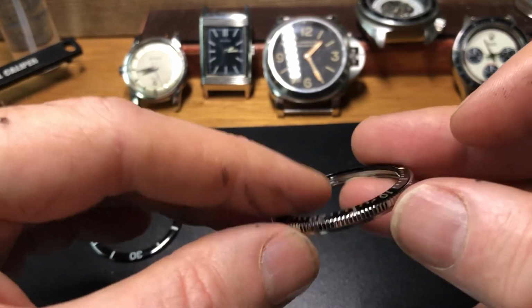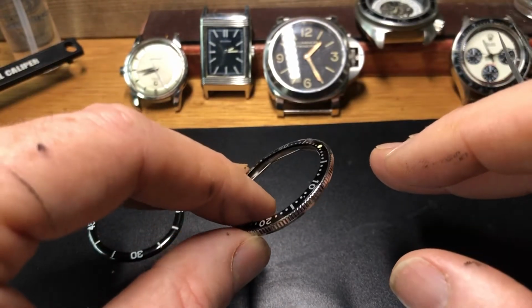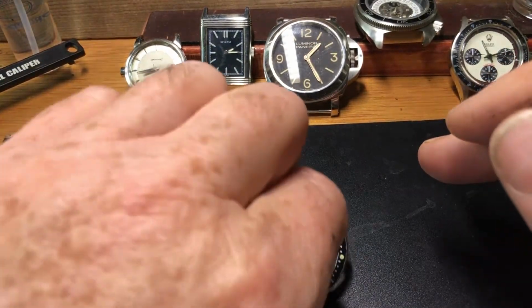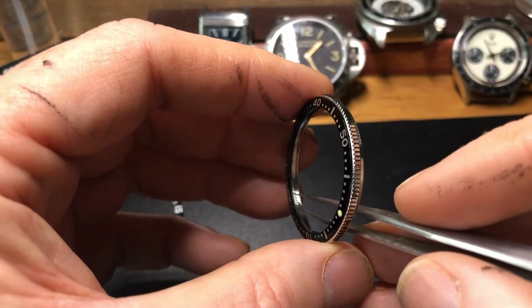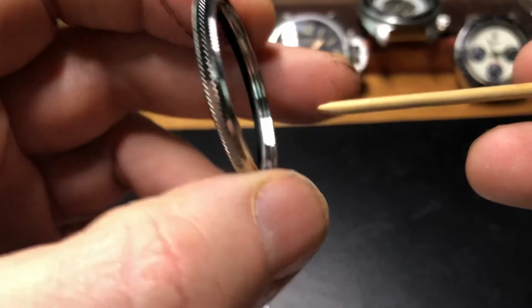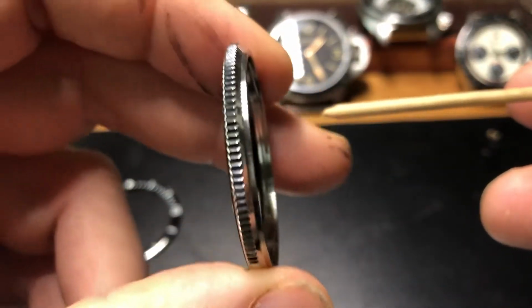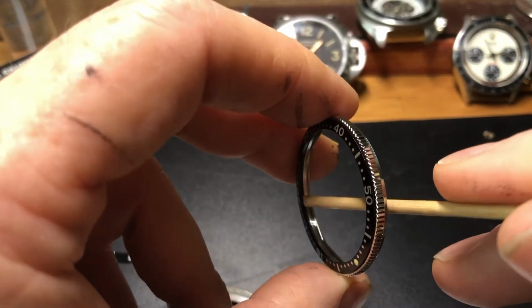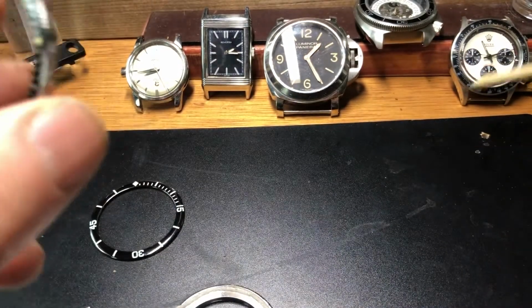These can get extremely hot. So you take a little plate on your cooking oven stove, you put it on heat, and you lay that there until you really can't touch it anymore. That softens the adhesive up so much that typically if you put a wooden peg in, something like that, I usually make them, I cut them like this. This is a bit old, but even better to more of a point, and then put that in there without burning my hands, and I twist it a little bit. It lifts up very easily because that heat makes that adhesive so very soft.